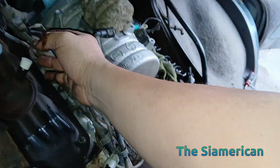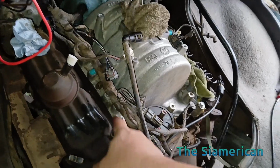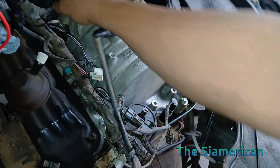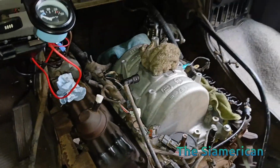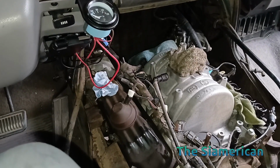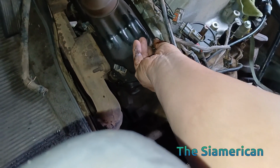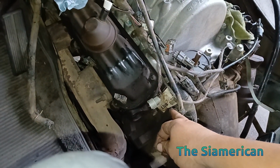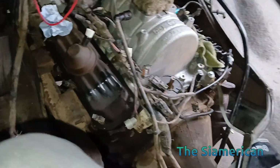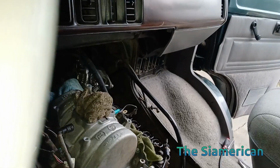This is the second from the back on the intake manifold side. So it's this special stud. It holds a clip for our fuel line. Harness clip here on that stud, and then our front on that is a bolt. So the 2 front ones are bolts. They should all be 11 mil or 7/16 sockets. We'll work to get these off, but barring this one, I'm not quite sure. This is like a bushing. Okay, so this is a bushing. So it's a stud and it has this bushing spacer, and then this clip goes on there, and then you probably put some other kind of nut or something to secure that if we can't get it to secure properly later. That bushing was for this stud to hold the fuel line clip.